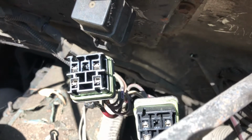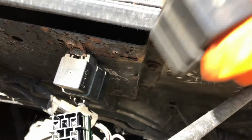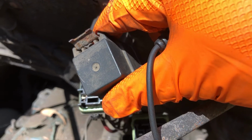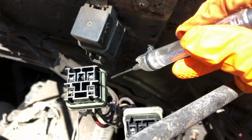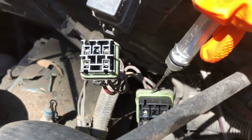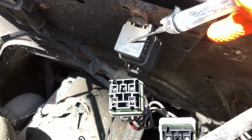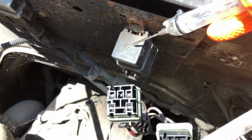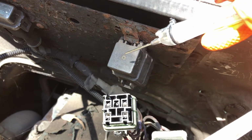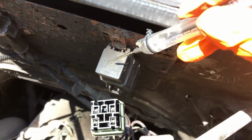When I connect this plug right here, I hear a click noise, click, click. It's supposed to have power, but when I connect my starter relay on this one, it's the same relay, the click is louder, and the power coming out through the purple wire is bright. So I try to connect my starter plug and this injector starter solenoid, and it doesn't connect the starter. So that means it disconnects, but just a little bit. They don't have enough power to crank the engine. So if they don't have enough power to crank the engine, they also don't have enough power to feed the injection system. So yeah, it looks good, but it's not good.